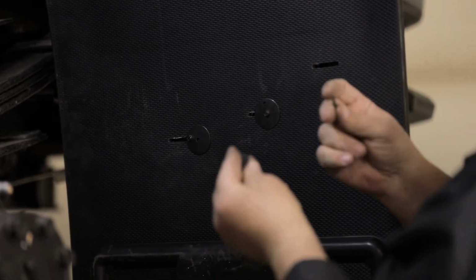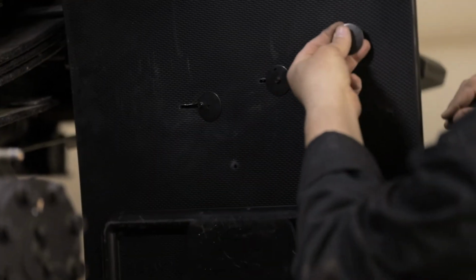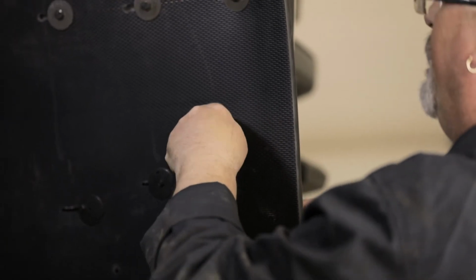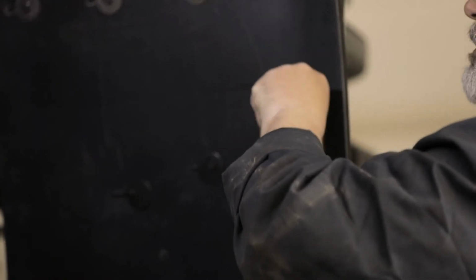Finally, secure the final hole of the flap by once again using a screw and offset washer. This time, use the outside hole of the washer, and position it facing downwards so that it applies pressure on the vehicle's factory protector.